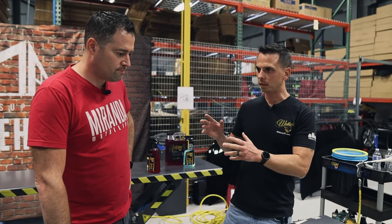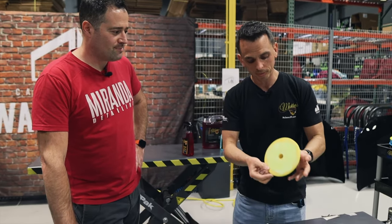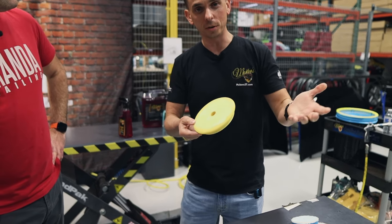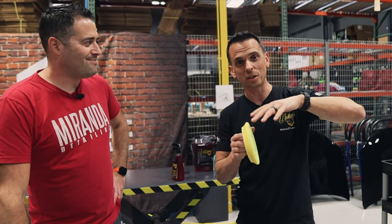If you clean your pads the right way using the right products and the right techniques, you can actually save yourself a lot of money by reusing the pads over and over again instead of throwing them out after one or two applications. Cleaning on the fly using an air compressor or a Tornador-type blowout system works well. The reason you clean your pads on the fly is that when you compound and polish you're removing clear coat, plus you have abrasives that broke down, silicones, solvents, and polish — all of that is on the face of the pad and in the pores of the pad. You don't want to grind that residue back into the paint. It's almost like using a microfiber and never washing it — you've got to wash all that stuff out and start fresh again.